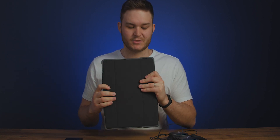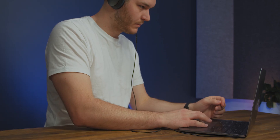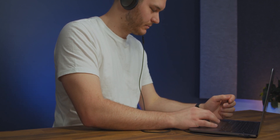So why is this the death of Made for Apple? With devices slowly removing the headphone jack — my iPad Pro still has it, thankfully — this standard will be disappearing. We're not going to see this on headphones anymore as they all move toward Bluetooth. MacBook Pros may still have a headphone jack, but people needing to buy specific headphones just to control their music on a MacBook probably isn't really needed when you're already on your computer. It'd be interesting to know how many of you have struggled with this, and if you knew why — the impedance levels for volume up and volume down.